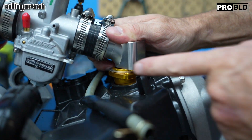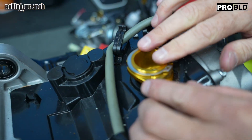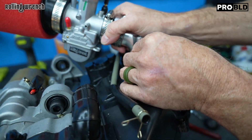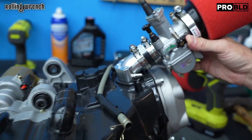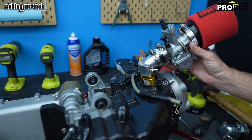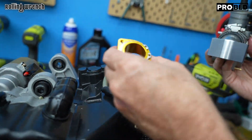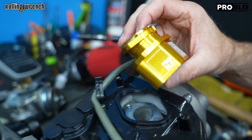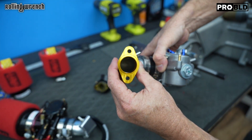See how I can move this around? That means when I bolt it up, I can pivot the carburetor any way I want, or flip it around. If I tried that without it, see how I'm hitting? There's another way too — we've got this clocking flange or intake spacer that can go in there, and you can just bolt it up like that. If all you need is height, you can just buy the spacer. Or you can double stack them — you can do the tall leveling clocking flange; this is a two-piece. Everything is 27.5 millimeter bore, and we use a Viton X-ring — notice it's square. Fuel will never warp or swell it, these things last forever and won't dry rot or crack like rubber.